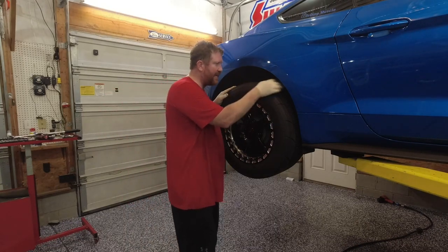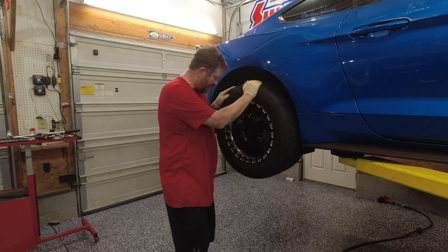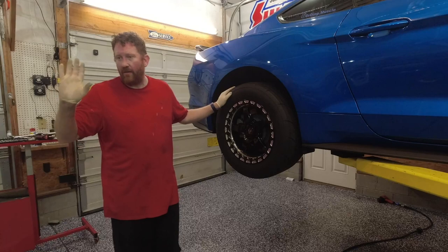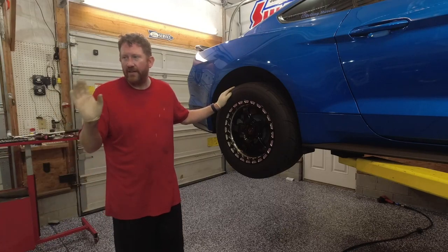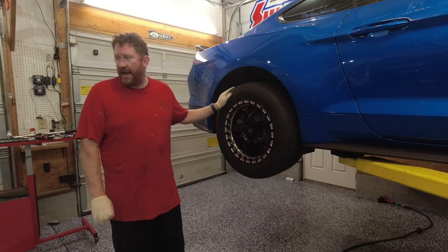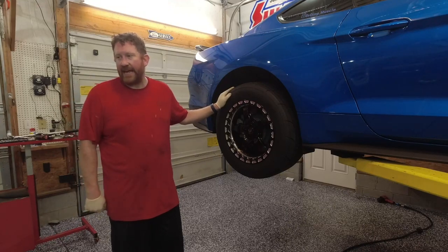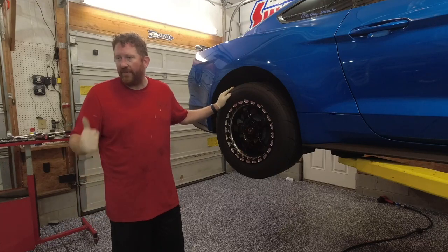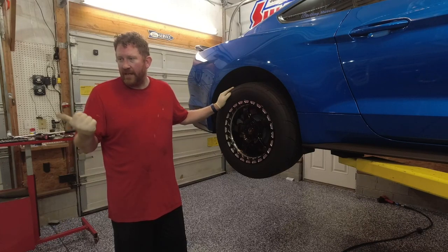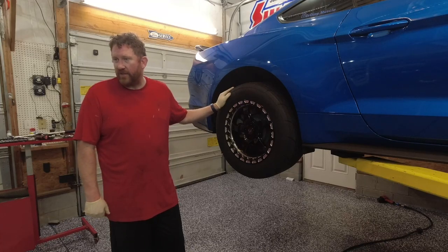Plans for this, hopes for this is low 10s, 10-teen, 10-20, something like that, hopefully. Would be freaking awesome as it sits. And then for the Fox, last time out, I don't know if you've seen the video yet. You might have about the Fox, but the last time out, it went 9.14 at 149. We are gonna do some things this weekend to try to get that 8 out of it. We're gonna bump the boost up a little bit on the leave, RPM up a little bit on the leave, and a little bit more boost further down track. See if we can't get it into the 8s, 8.80s, 8.90s, probably somewhere in there. So that's what's coming up this weekend.